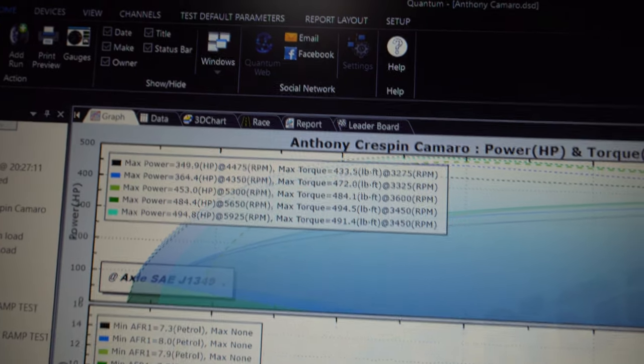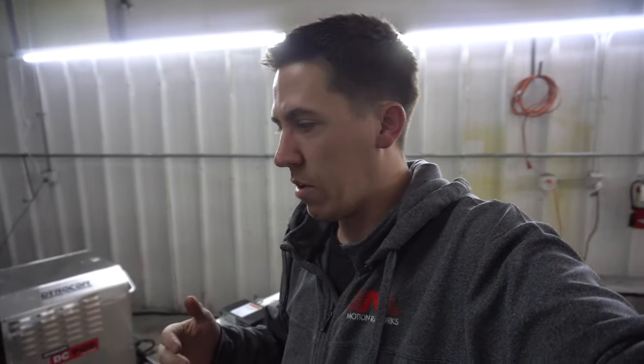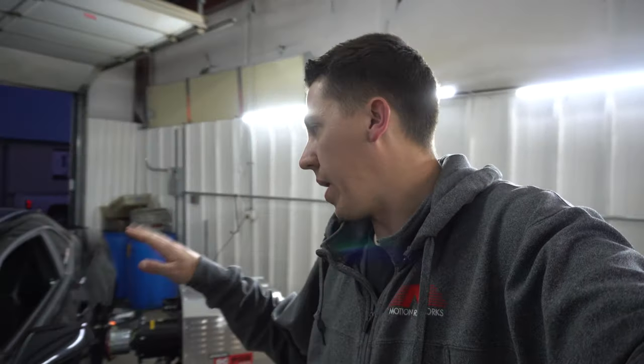That's what it looks like towards the end — it ended up making 494 horsepower and 491 torque. That's probably all we want to really rev this combo, about 6,800 RPM. It's starting to knock right around the 6,500 to 6,700 RPM range, so I actually need to pull a few degrees of timing out. During normal conditions you don't want it to knock — if you're doing a burnout or racing it, you try to always keep it safe. You don't want the tune on the ragged edge of always wanting to knock, even though that's how the factory does it often. I'm going to make those timing adjustments, flash the tune for the last time, and call it a day.